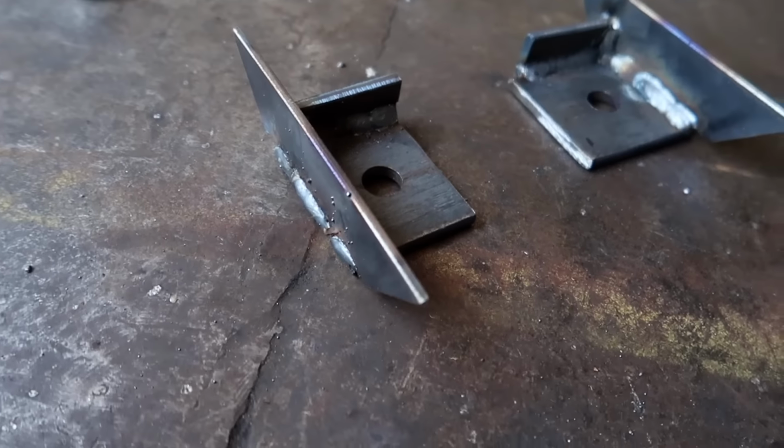And then I've got these 1 inch flat bar pieces that I'll weld into place and bend around so that the corners on the subframe will match the 1 inch radius that I plan on putting on the camper. Alright, so we got all the work done that we're going to get done with the subframe bolted in place. So we're going to be taking it off the truck and maneuvering it around so that I can get some more welds on there.